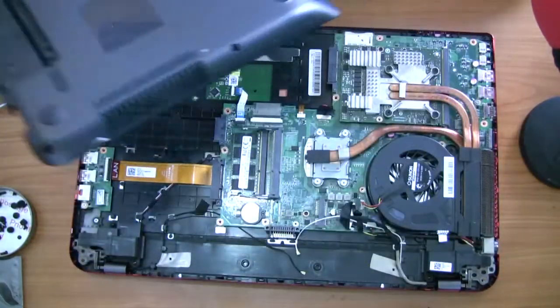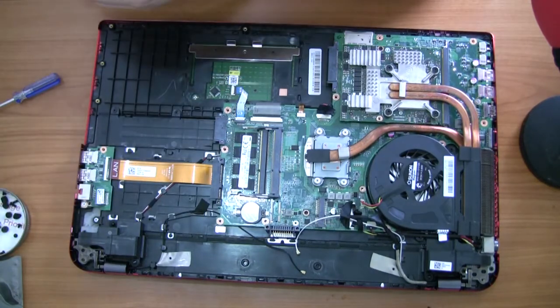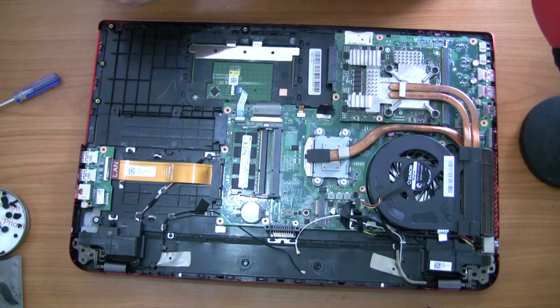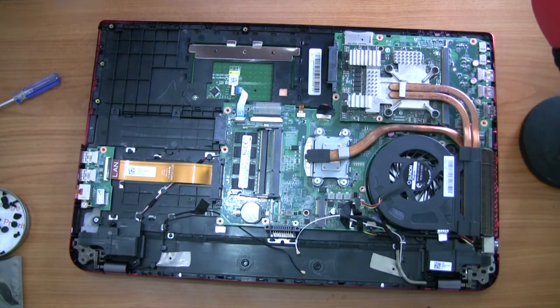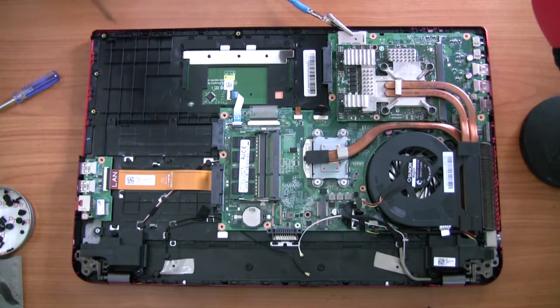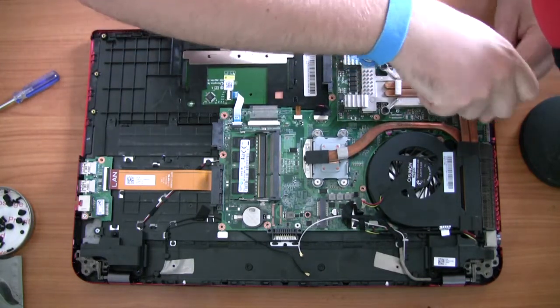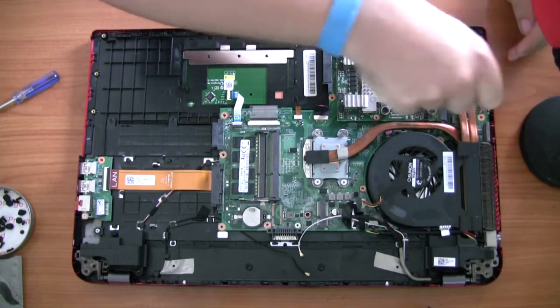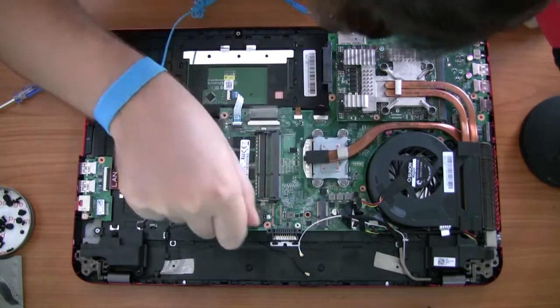With those little tabs that go under the battery, you just want to push on them and lift and they come straight off. It's pretty simple, and even though you didn't see me taking this off the first time, it actually does come off really easy. Now with the back case removed, you're going to want to grab an anti-static wristband — the best area to clip onto is the SD card slot or the shielding.